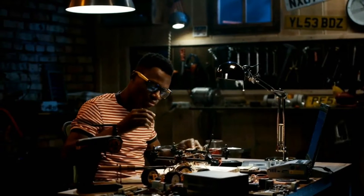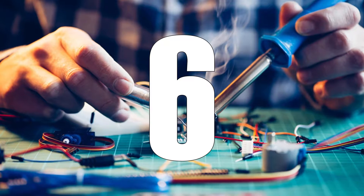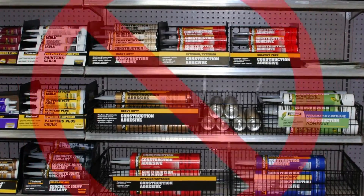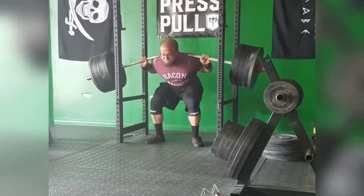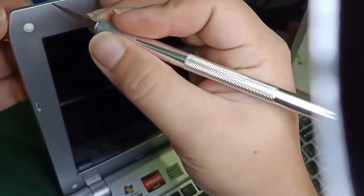Let us proceed to the second part on how to repair your screen and handle it correctly. We have six to seven steps for this process. Note that laptop manufacturers do not use adhesive to stick together their parts — it only consists of overlapping plastic locks and screws. So be gentle, avoid using excessive force to open something up, and be patient.